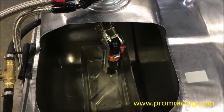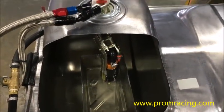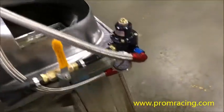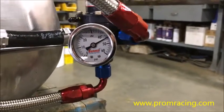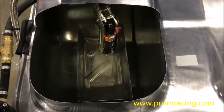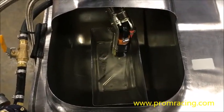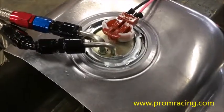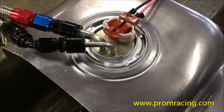So we've now demonstrated to you the difference between the Pro-Am Racing hanger and the original Ford hanger, and how the Pro-Am hanger eliminates the aeration and cavitation problem associated with the original Ford hanger. But I also keep showing you the fuel pressure — I'm doing that for a reason. I'm going to turn on the pump. You saw that the fuel pressure was now up around 46-47 psi, and if you looked carefully you saw that the needle was actually bouncing around a little bit. I want to make it clear we did not adjust the fuel pressure regulator. The stock Mustang fuel pump hanger has a quarter-inch return line — it is not able to flow 255 liters per hour, never mind 340 or 400.